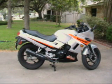2 carburetors. It's got a transistor ignition system. And it uses 10W40 oil is what they recommend. We'll talk more about oil maybe in the future. And a 6-speed transmission with a wet clutch. That's the basic specifications of it.